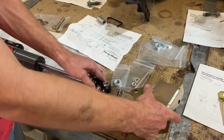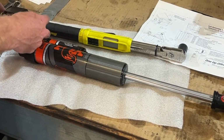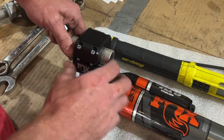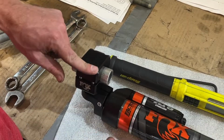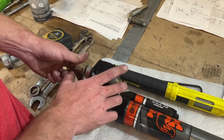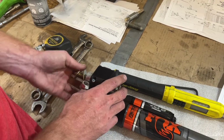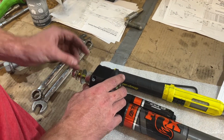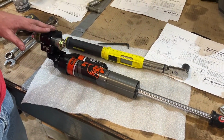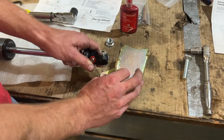So we got the ATS on the table here. We can start getting this thing assembled. First up, we'll take the rod end. I showed you how to get this in here. We checked the bolt length. We can install our bolt with the big washer and another big washer, and then a small washer and nut. We'll just leave this loose until we go into the truck with it. And then we can go ahead and torque these down. These are all going to go to 12 foot-pounds. We'll do that next. We'll start over here then at the pitman arm side.